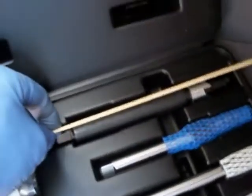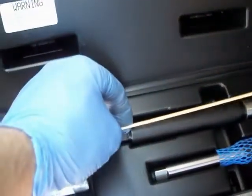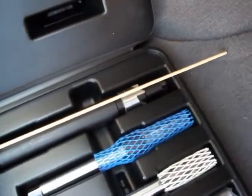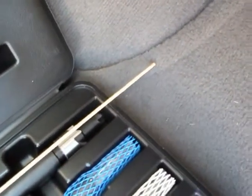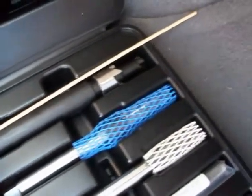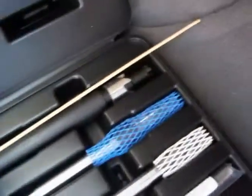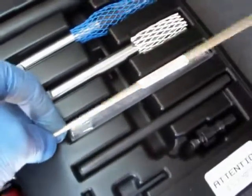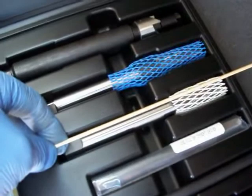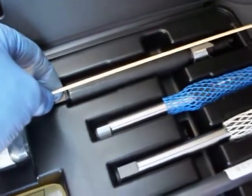If I hold the skewer at the point where it hit the piston, here's the top of the spark plug hole where my finger is, and here's how long the whole insert is, and that's where it bumped the top of the piston. So it looks like even if I ran this tool all the way in — flush with the top of the spark plug hole on the top of the head — I still wouldn't have any chance of hitting the piston. Looking at the setter and the tap, there's no chance of it bumping the piston. That looks good.